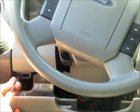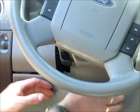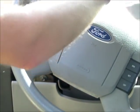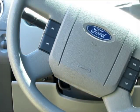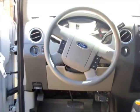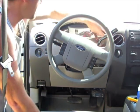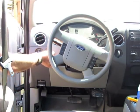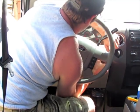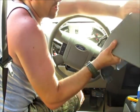There's one on the opposite side as well. Next, you'll want to lower the steering column into the lowest position. Then we'll pop the plastic up around here on each side off by simply pulling and lifting this cluster cover up out of the way.